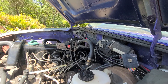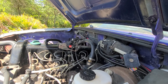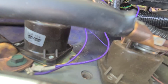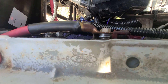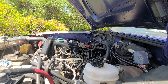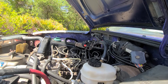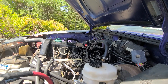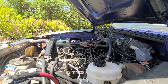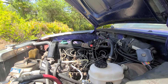Whenever the factory engine has sufficient oil pressure, it just grounds the sensor, so I have it going right over here to ground. Whenever the key is on, it gets grounded out and that works. I believe I messed up the cluster when I took it apart, so I'm going to put the factory one back in and see if it works — it was working perfectly fine prior.